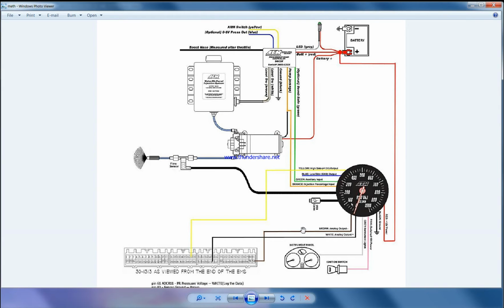We discontinued using this because if at any point this controller gets damaged, it will give a back voltage to the ECU and damage the ECU, and you can prevent it by using a diode. But normally I stopped using every kit which has a connection to the ECU or a wiring harness on the stock car, because we had some bad issues.